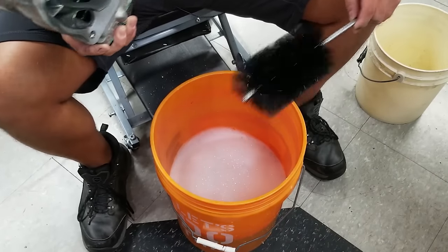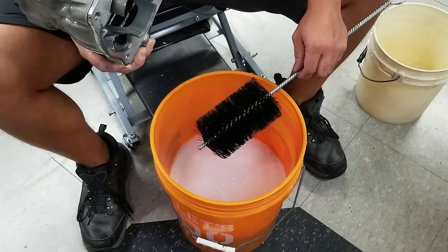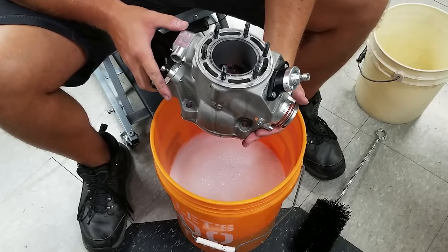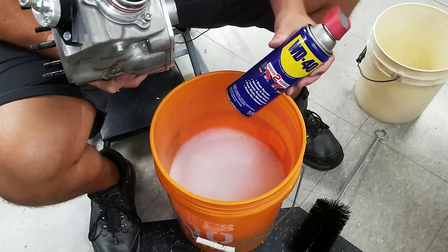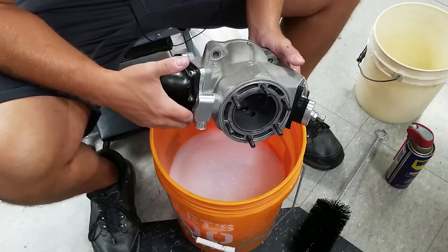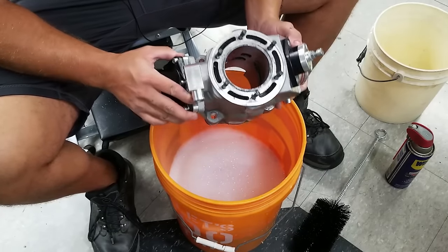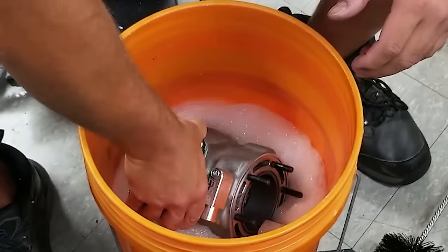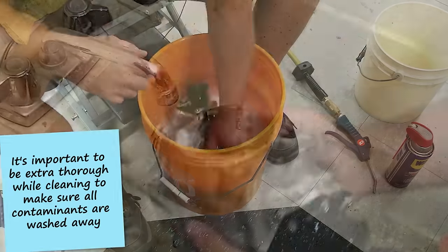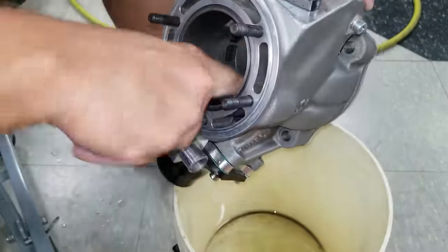Now I've got a bucket of soapy water and a bore scrubber from Brush Research that's made specifically for this bore size. Just dish detergent and hot soapy water — they specifically tell you not to use brake clean. I have WD-40 on hand as well, because as soon as you dry the cylinder you want to get some oil in the sleeve right away, otherwise it will start rusting pretty much immediately. Ideally you should remove your reeds, power valve, and exhaust flange, but I did such a good job RTV-ing this, so I'm just going to be extra careful making sure it's super dry.